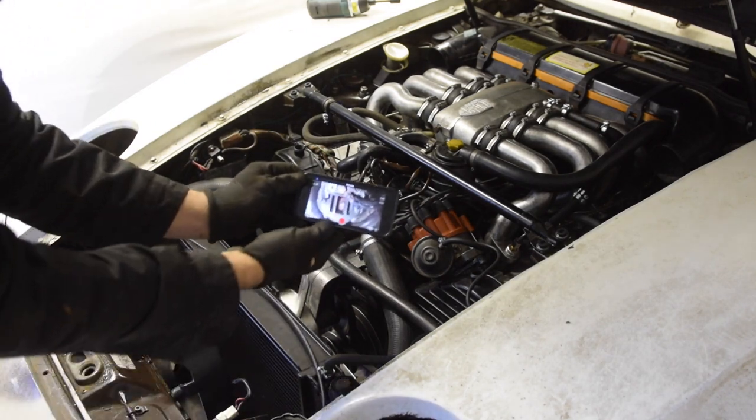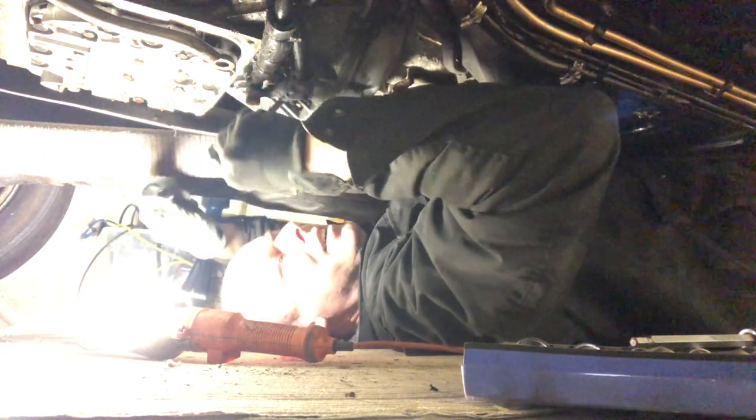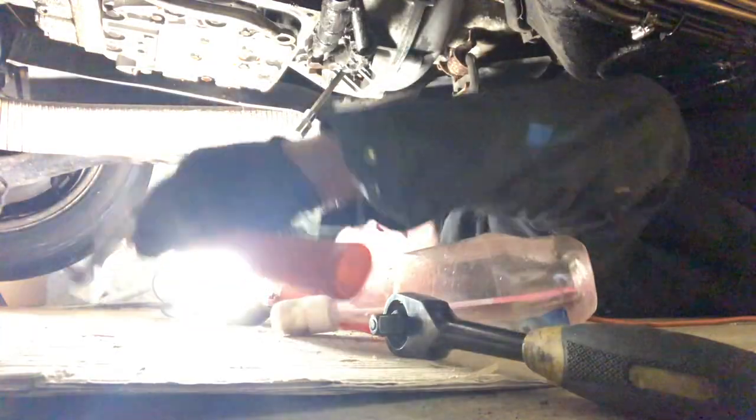I don't know if you can see from there, but that lines up now perfectly. It's not the most comfortable position, but I've got my nice long allen key here. Let me have a quick look at the size — it's a 5mm allen head. That goes into the torque converter. I may actually go get a hammer and give it a couple of taps just to really check it's pushed in there, because we're going to have one go at this and if it strips I'm pretty much screwed.